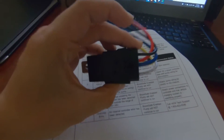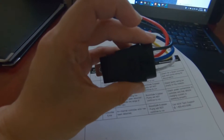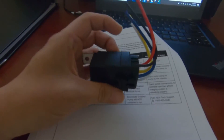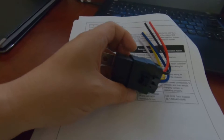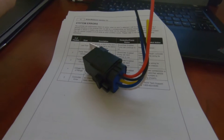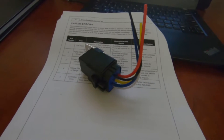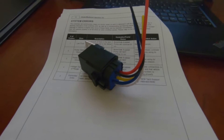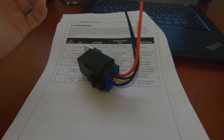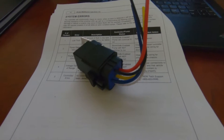The reason I chose this method over using the TGV signal is that I'm running a flex fuel kit that uses that output, so we don't know exactly what would happen if you throw an error code over it. I was told by Clark Turner that it goes to a pump gas map, but we didn't want to risk that. We felt a boost cut would be a lot more evident as a fail safe.